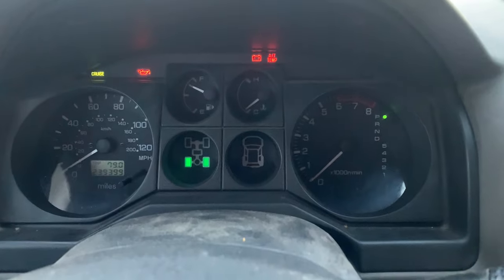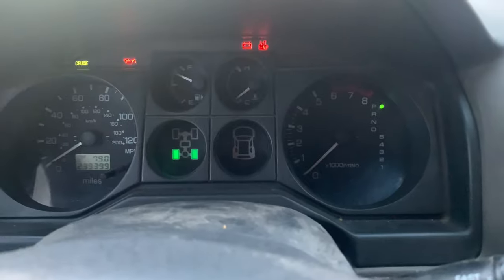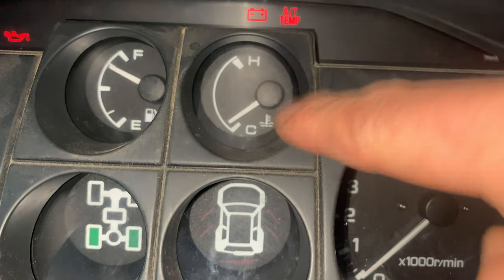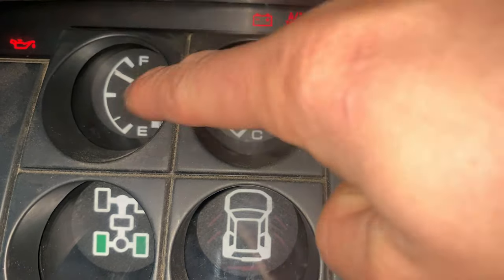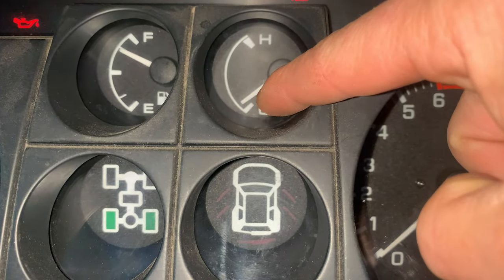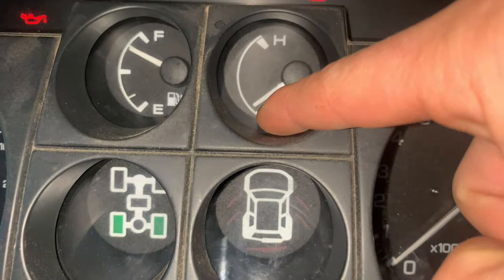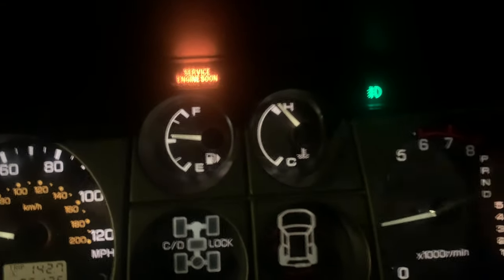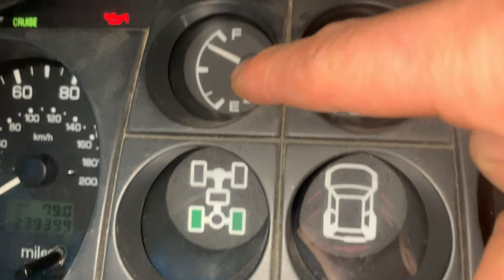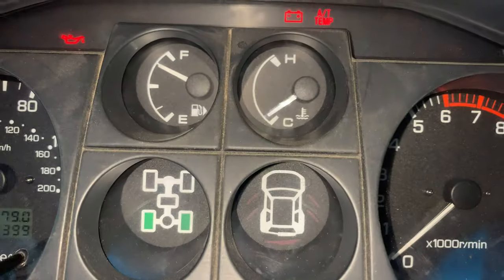The last interior issues become obvious when you turn the car on. The first is that the temperature gauge or sometimes the gas gauge has a broken resistor. What happens is the temp gauge skyrockets to high — you'll see guys asking questions because this thing is pegged all the way to the top, but their car is actually fine and not overheating — the resistor is just bad and reads high. Same with the gas gauge: it might read way lower than it actually is because of that faulty resistor.